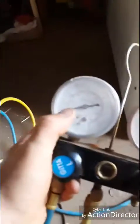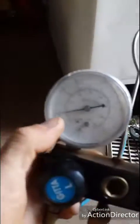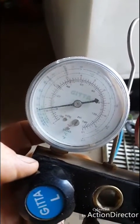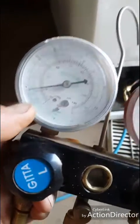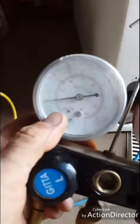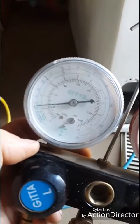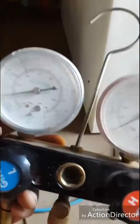It all looks good. This is very interesting — I had to take out a lot of the gas because I had a lot of ice build up on the suction line. So look at that — that is really low pressure. This is for 134A. It's because I only have like 29 meters of copper pipe in here. Normal fridges have got much more piping on the inside which takes a lot more gas. So there it's running on optimum — that's about 1, 2, 3 PSI. It's all charged up.